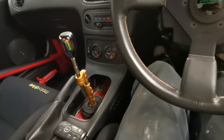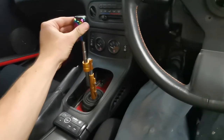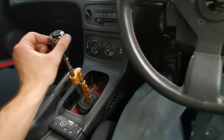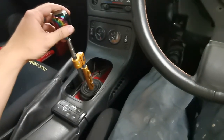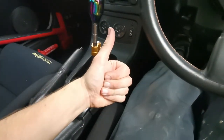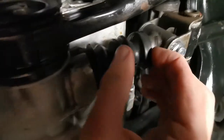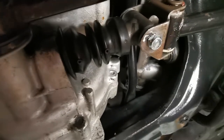Well, to be honest it's not had a massive effect — there's still a fair bit of side-to-side play there. I'm sure it's a bit less than it was before, but where exactly the play is coming from I don't know now. All I can think is it's inside the gearbox itself, but all things considered for a quarter-of-a-century-old car the shift is pretty bob on. There's basically no movement at all in that universal joint — all of it seems to be inside the box itself, so I can't do any more than that.